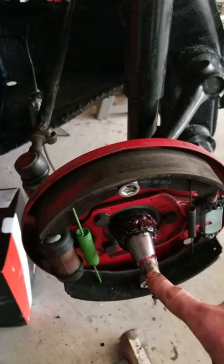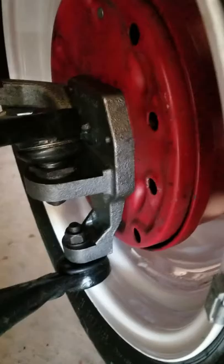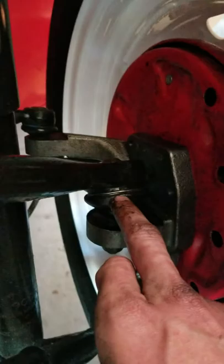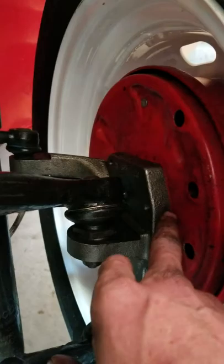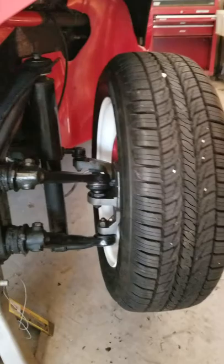I'll give you a picture of the side that's completed already, and that's over here. So you see everything's kind of cleaned up. There's your locking ring right here. Brakes came in, and this 2.5-inch drop moved the spindle center from here between these two arms 2.5 inches up behind this arm right here. So it gives you a lower profile on the front.